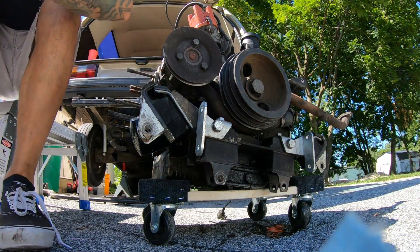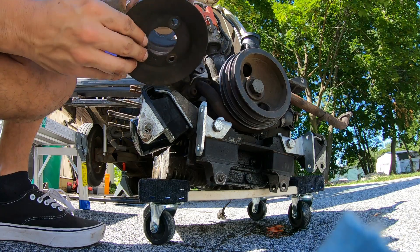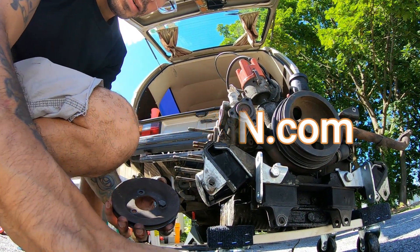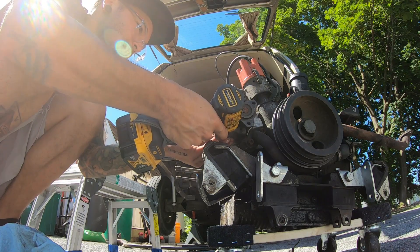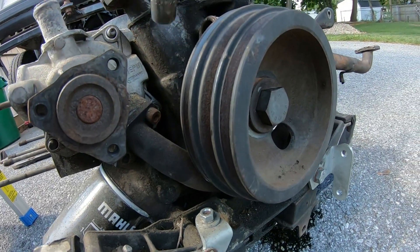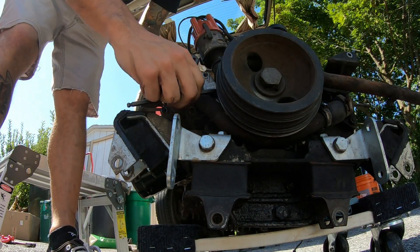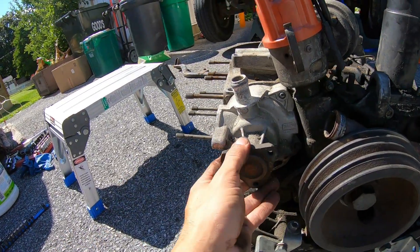Probably 13mm — yep. I'm not sure if it's supposed to do that. If you're a Volkswagen person, is it supposed to separate like this? I did order a new pump and I got that from vanagain.com. I was able to take off this nut and that nut, but I can't get to this one down here because the crank pulley is in the way, so I'm gonna have to take off this water line. I needed to use a six millimeter allen to get in that spot because it's super super tight. A little nervous — I thought I was gonna break it. One quarter turn at a time — water pump is loose and now coming out.